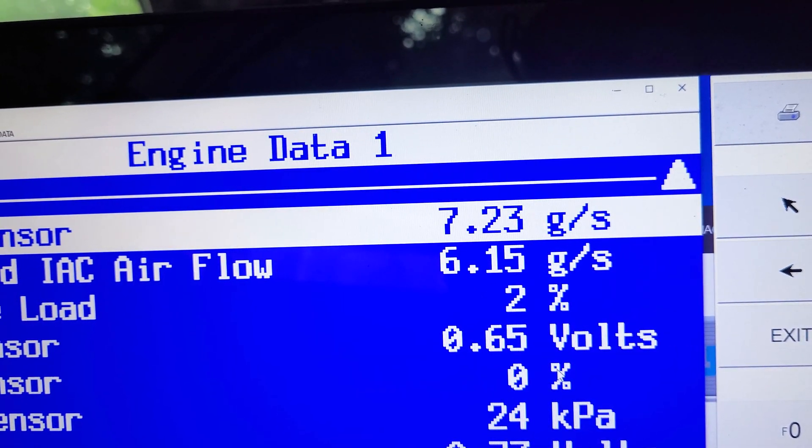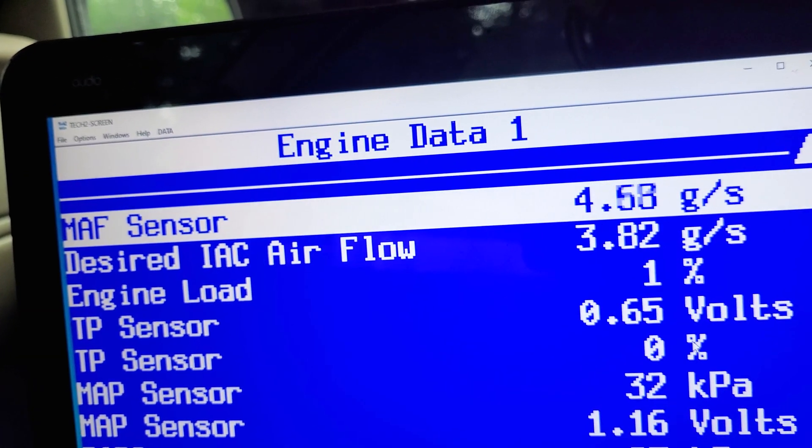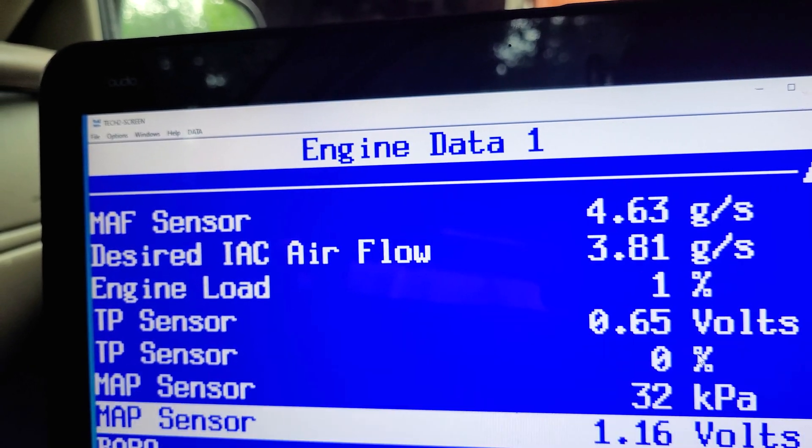You can see if you really tap the gas pedal, see how fast and how high it goes up — that can be tricky to diagnose. Normally if you just get the code, you swap it out and you're good. For diagnostic purposes, I've watched the mass airflow sensor on these trucks with an oscilloscope. The electronic systems on these trucks are pretty noisy — the sensors are pretty simple once you figure out how they work. They just meter the air and relay it back to the computer. The computer checks a couple of things and determines if the sensor's good or bad, and if it fails enough checks it'll throw a code for the mass airflow sensor — replace it.